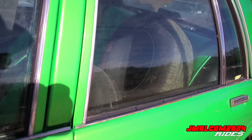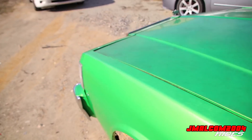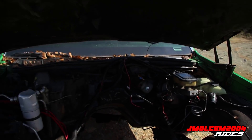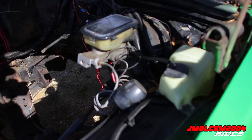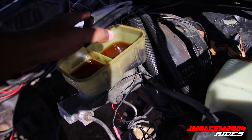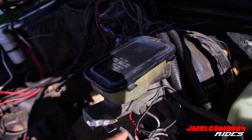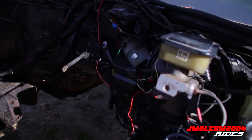Safety first with me, I don't care what nobody's talking about. It's a budget build, but you don't go budget on your safety — that's just what it is. I'm finna pull up on Don't Panic Customs, his other shop. I was up underneath the hood looking at all the brake components, and I'm gonna buy a new master cylinder. See that — it ain't tight, it's low, but it won't bite no more, so I'm gonna buy a whole new master cylinder.